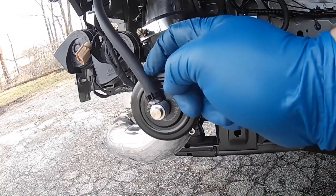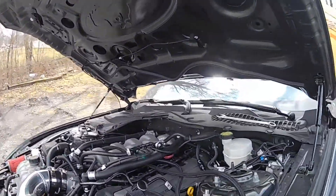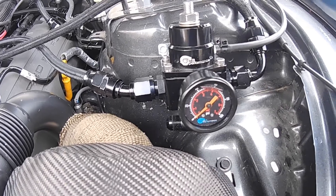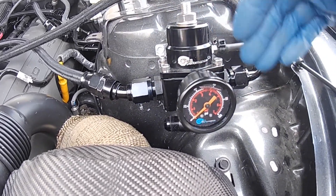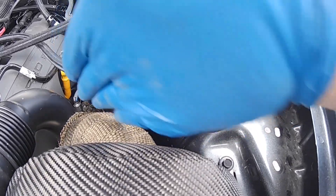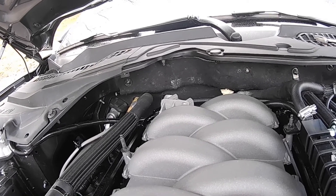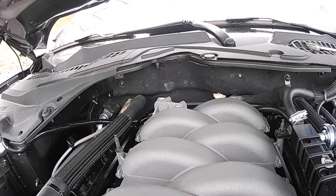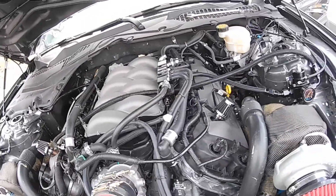Here's the blow-off valve vacuum line — zip-tied all the connector parts so nothing slides off. I moved my fuel pressure regulator here. I know it's close to the downpipe, so I have some DEI heat wrap coming — the sheaths — and I'm going to sheath the lines and probably make a little heat shield that bolts in between to keep it away. Where I had it originally on the firewall is not NHRA legal, so if you race at any NHRA-sanctioned tracks you could possibly fail tech. I wanted to eliminate that issue right away.